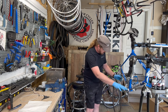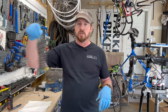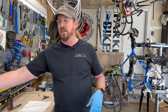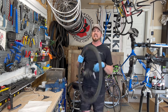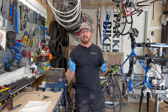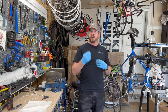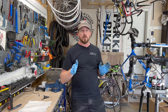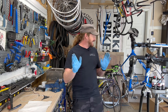The chain is no good, as expected. He opted for the wax chain treatment, so I waxed the chains yesterday — you can see they're still hard and waxy. I'll break them free, measure, and install once everything's been cleaned. The trick with wax chains is you want everything ultrasonic clean, free from any contaminants and old grease, to give the wax the best chance to do its magic. It takes about five to ten miles of riding for the chain to break in and shed the extra wax.